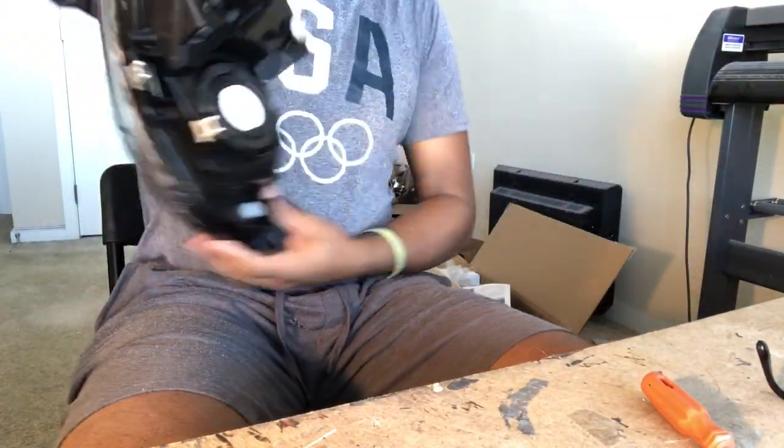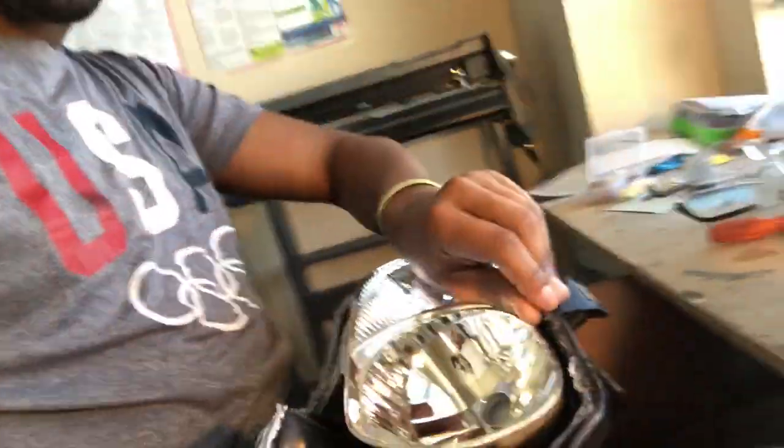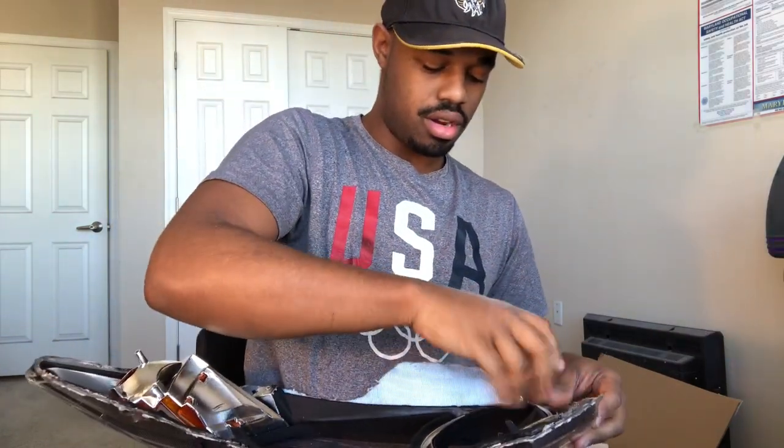With that screw removed, the lens can just come right out — that's pretty much how you get them open without dealing with the long process of opening permasealed headlights. With this set, everything is getting removed and painted, then once done they can get closed up. You can take your screwdriver and unscrew all the plastic trim in there — that way if you want to add LED strips you can, and if you want to do your amber delete, you can do that too.